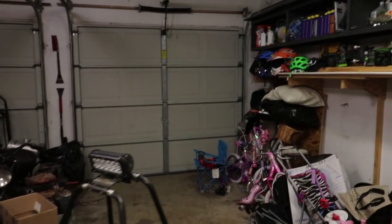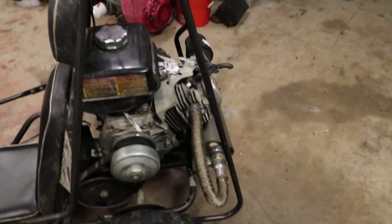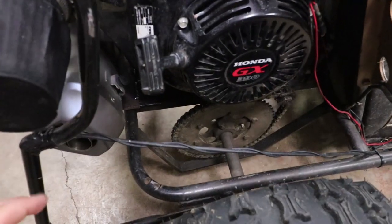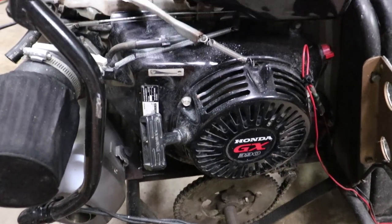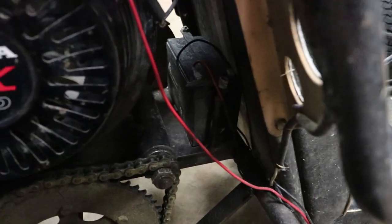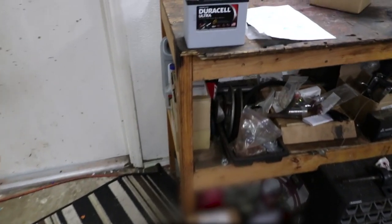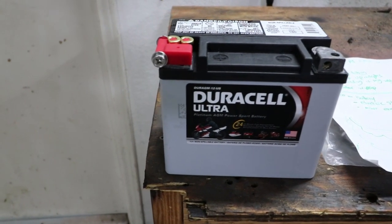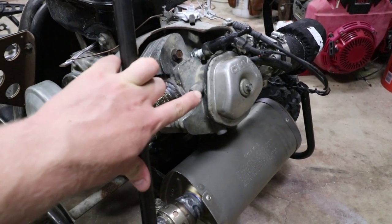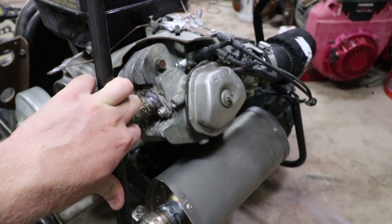So there you have it for now. Any of my builds are kind of a work in progress and there's a few things I'm planning on doing. I actually want to make this electric start — if you take a look down here there's no starter on it, so I want to rob the electric start system from my 11 horsepower GX340 and replace the flywheel here. This old battery I got off eBay for like 15 bucks crapped out on me, so I actually got a brand new Duracell battery for power sport engines. Just a few minor engine tweaks — I might replace the head gasket with something a little bit smaller and do a little bit of port work to get better high-end RPMs. Give the video a thumbs up and we'll catch you in the next one.